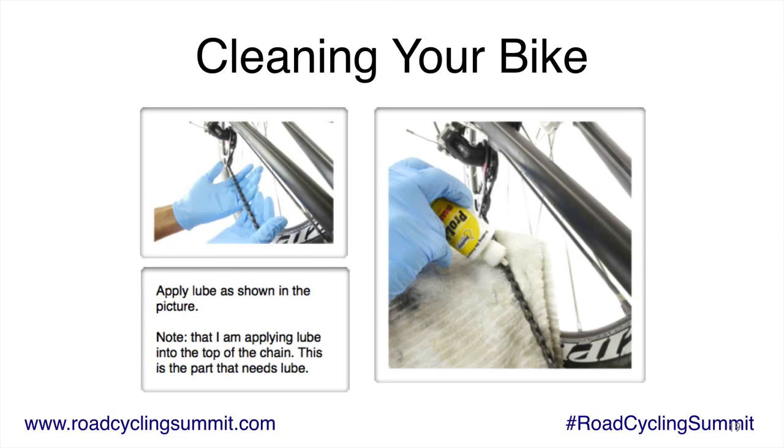Okay, and then, of course, after you clean your bike, you wash it, then you need to lube it. Anytime your bike gets wet, you need to lube the chain afterwards. So if you're in the rain, you need to lube the chain. There are some lubes out there that can tolerate the rain better, and you might be able to get away with it, but they tend to be really viscous and really greasy and cause a lot of buildup. So I'll leave that up to you. That's your choice. But whatever lube that you do use, the application method is essentially the same.